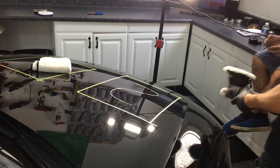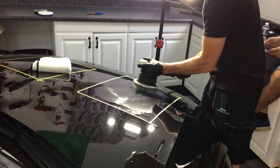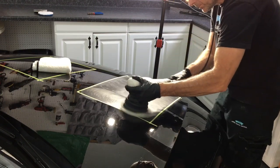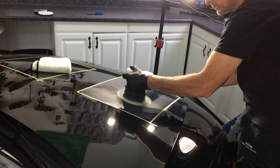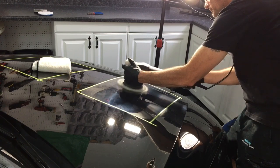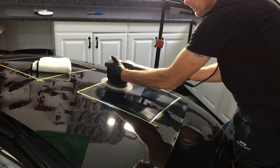I want to show you that you can use the Lake Country Low Lint Pre-Wash Lambs Wool Pad on a long throw polisher. On the test area on the driver's side, the 50-50 pad is perfectly fine for what we have there. This hood is beat up, it's trashed. With the Low Lint Pad, you want to make sure that pad is placed perfectly, centered, to avoid any type of wobble with your long throw polisher. A 21 millimeter throw is great; a 15 millimeter will work. Anything lower than 15 millimeter, you're really not doing too much. As you can see, the polisher has a little bit of wobble — I purposely left it off center. If you have it perfectly centered at the right speed — a little bit higher than third or fourth — you'll get a nice smooth ride and really effective cut from your long throw polisher with the Lake Country Wool Pad.